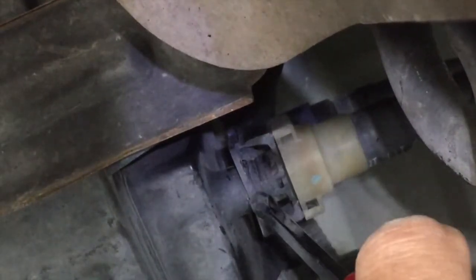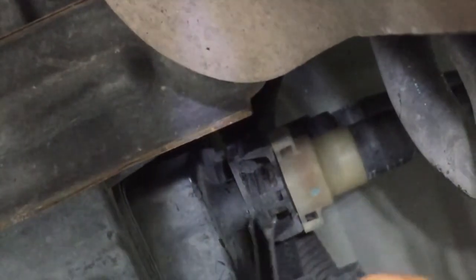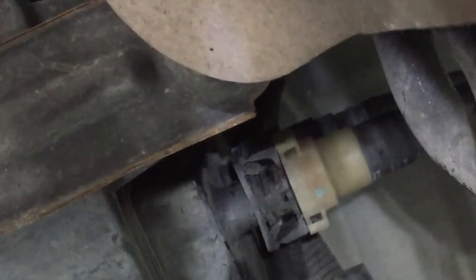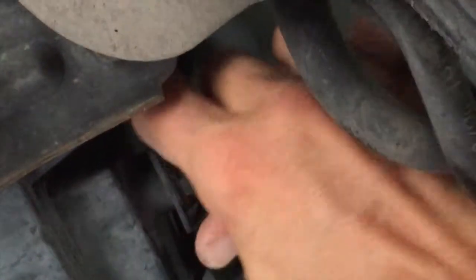And then ultimately what I did is I bent this and I put a screwdriver here and pushed, kind of held it over this little angled part over the ring. So I just had one, so that way I held this one over like that, and then I got another screwdriver and put it on the other side. While I was holding this one in place, I pried this one with a second screwdriver, and then I pushed from both sides with 2 different screwdrivers, and then allowed it to slide over the ring that's holding it here that you're trying to get these little tabs over, and that allowed it to slide out. So hopefully that's a good little tip there to help you get this guy off.